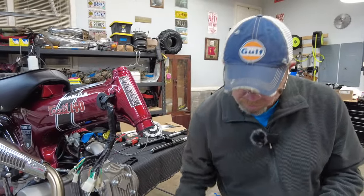Got the handlebars bolted back on. Last thing before we get this off the rack: your brake lever slash master cylinder — these are 8mm bolts on the clamp on the back. I'm not going to permanently fix this just yet until I know exactly where I'm going to position my throttle grip when I put it all back together. For now I'm just going to mock these up on there for the purposes of this video. Give me a second to get this off the table and we'll get it on the ground and get some impressions of this setup.